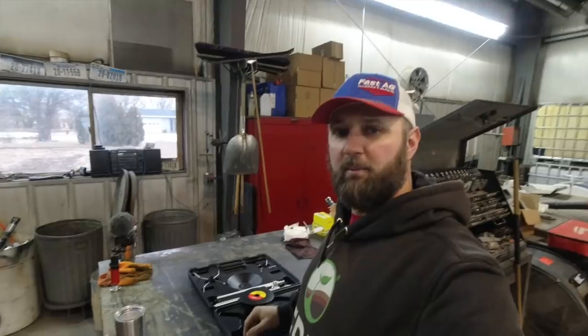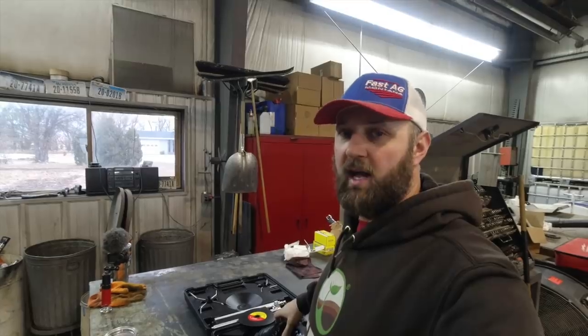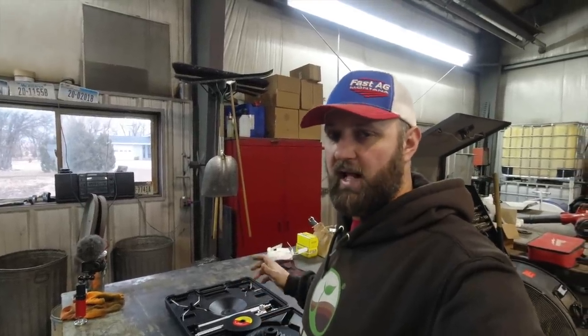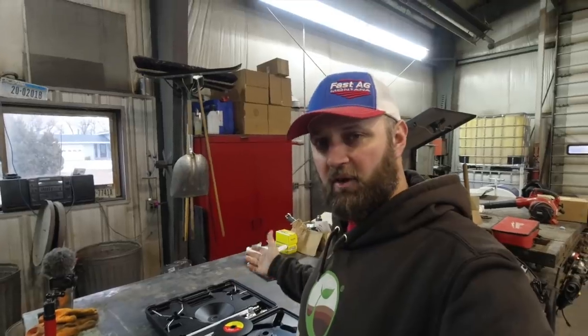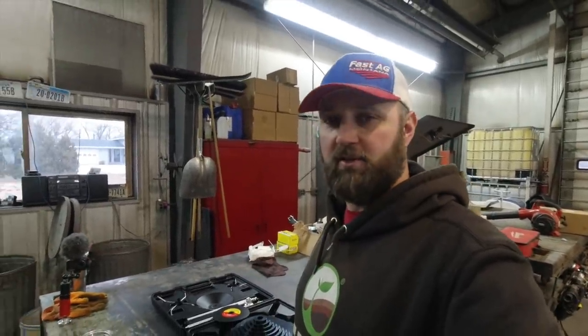Thanks for reaching out to these companies, guys. Really appreciate it. And before you guys get all huffy puffy about blowing out air filters, I never touched the secondary or the inner filter because that is your safety net so you don't dust an engine. If you poke a little hole through an outer filter accidentally, your inner filter is still going to keep the dirt out. So that's my theory on filters and I'm sticking to it.